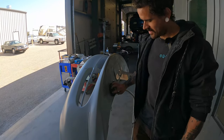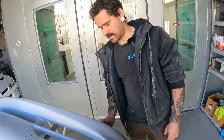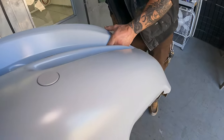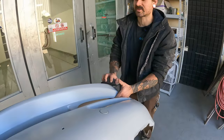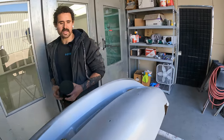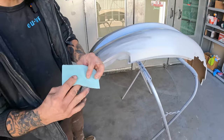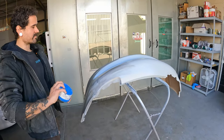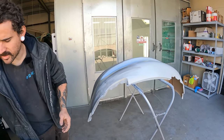So all this stuff came with a really nice factory primer on it. The bumpers don't look chewed up at all — no damage on any of the parts. So all I'm going to do is go around and put some guide coat on this so I don't miss anything. Make sure I'm getting all these nooks and crannies real good, and just give it a nice hand sand in 600 with some flexible sheets. Then we'll probably go over it with the scotch pad with the scuff stuff — get it all nice and cleaned up and ready to go.